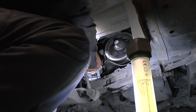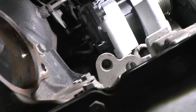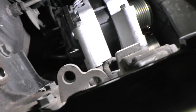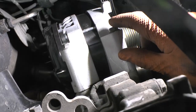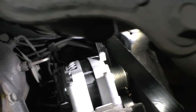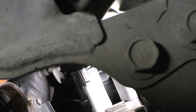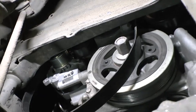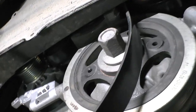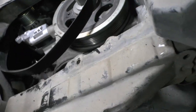The drive shaft opening is visible there with the drive shaft out — it didn't drip because the car is tilted to the other side. These bolts — one, two, three — I couldn't find the torque settings so I'm doing them up to 30Nm, which seems plenty. That is the alternator fitted — incredibly hard to get to, you can just see it there. Just trying to get the belt back on now.